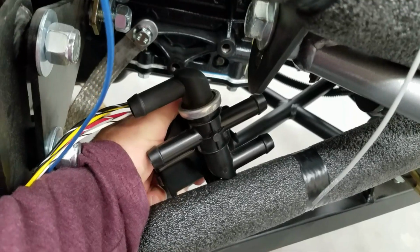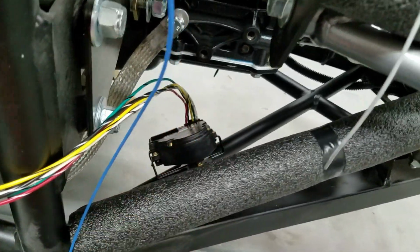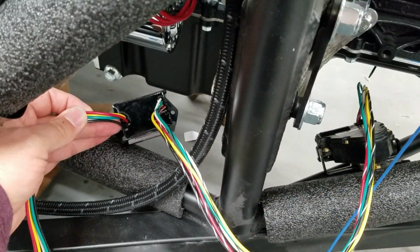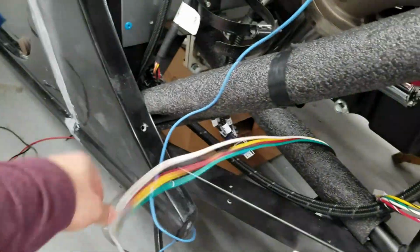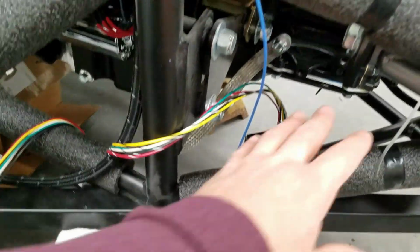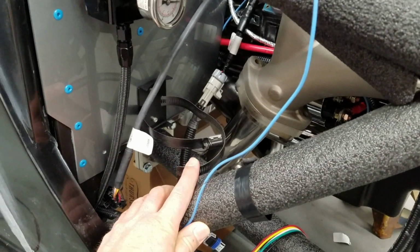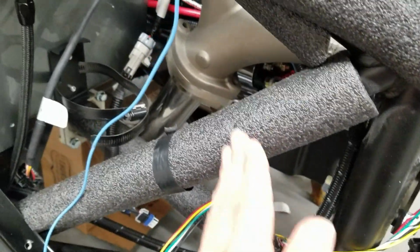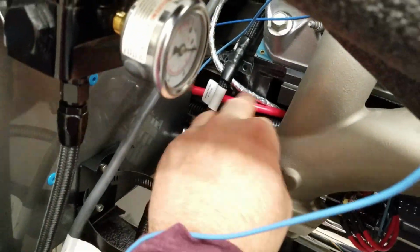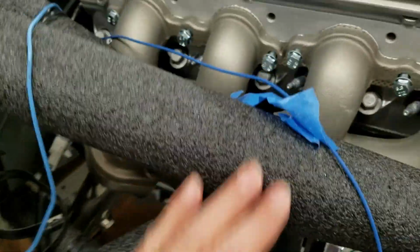The other thing I wanted to show you is for the air conditioning system, you have this basically valve, I guess, with a bunch of hoses going to it. But then you have to get all the wiring, which comes to one of these, which I'm assuming is kind of a control relay, if you will. All these wires have to go either into the dash or into the dryer here. So I'm slowly mapping out where this might go to see how much wire I need and how to get around the exhaust pipe. That's why on this one I put a connector on it, because it probably needs to go in a loom with all these cables and then be nicely covered like this one and go through. I want to be able to do that later so it has a little bit more heat protection and stuff.